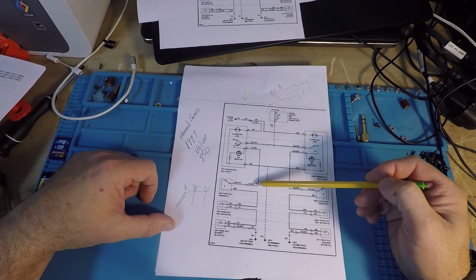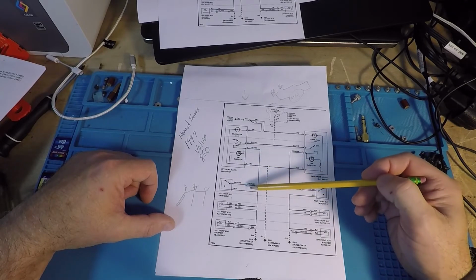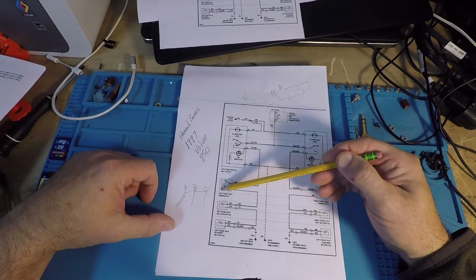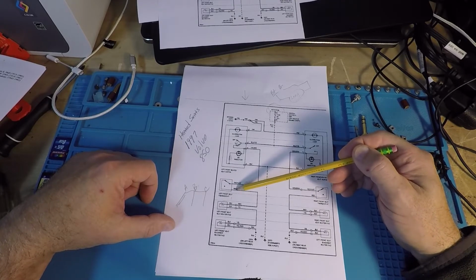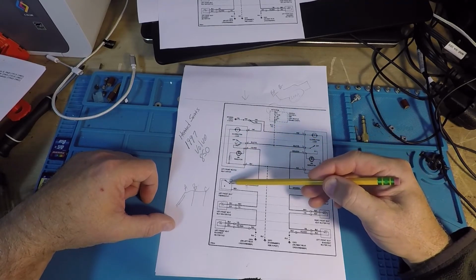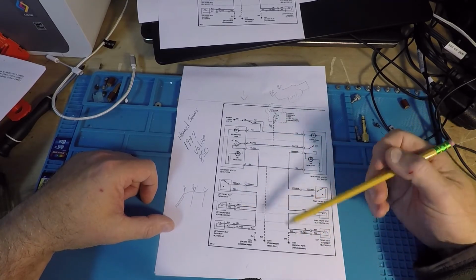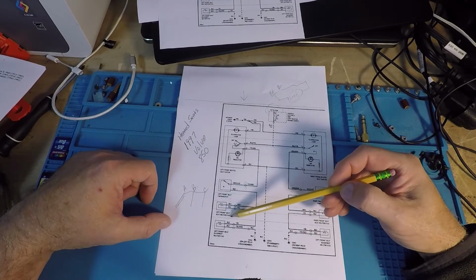So the yellow-red, notice here it has a connection. There's a connector. It changes to red-white, and this is under the seat, and I'll show it to you. The red-white wire goes to the thermostat, and it comes out of the thermostat and changes colors again. Now, don't let this confuse you. It's not that bad. So, switch is on. Thermostat's good. I should have B+ power to this red wire. Okay. Now, B+ power to the red wire, that goes into the seat heating pad.